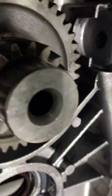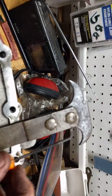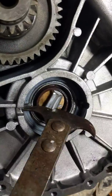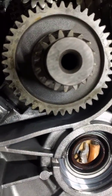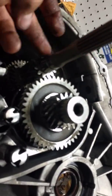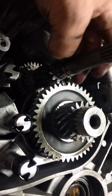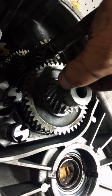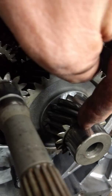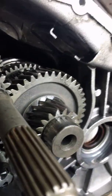For example, how do you remove this bearing race that was in here? Well, I used a mixture of these two tools: a seal puller and a little hook screwdriver, which I used to add an additional fulcrum as I was pulling it. I had to just sit there and leverage, leverage, leverage — it took me about five minutes to get the bearing race out. Giving a physical inspection around this bearing race, this one is fine, but this one has a little flaw on it right there. What I'll do is take a little grinding stone to smooth out the edges so it doesn't catch on the new bearing.